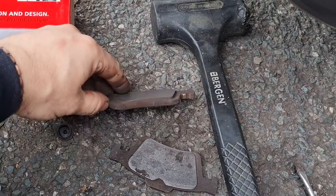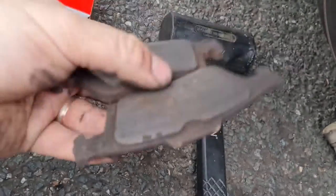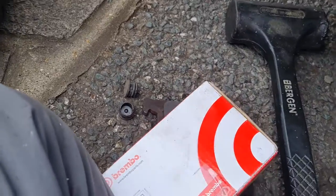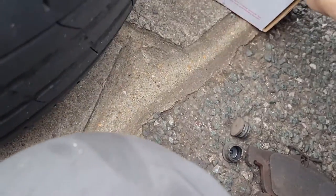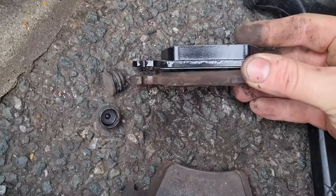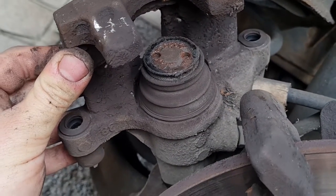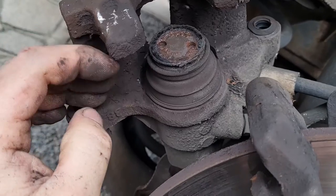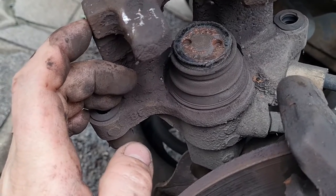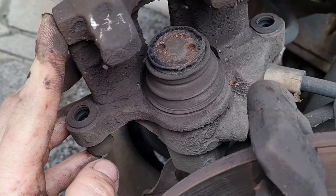Pads are off. As you can see they're not completely down to nothing, they're a little bit low. I haven't got the new ones out the box yet so I don't know how much meat they come with, but I'd imagine it's probably a fair bit more. Yeah, you can see what they come with from new — quite a difference — and you can see the piston is out a fair way. Now on this, because it's got rear calipers, on a lot of modern cars you have to use a wind-back tool on the rear piston. You can see the two holes in the top of it — that uses a special wind-back tool which fits inside the caliper and you turn it to make it go back in.